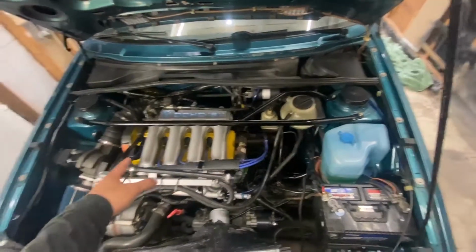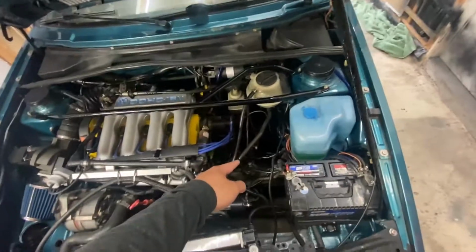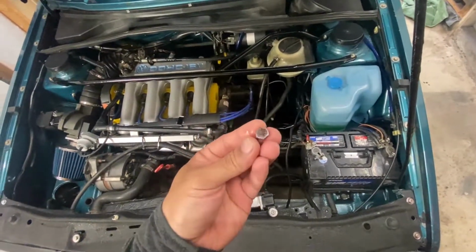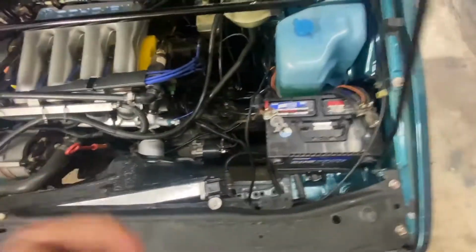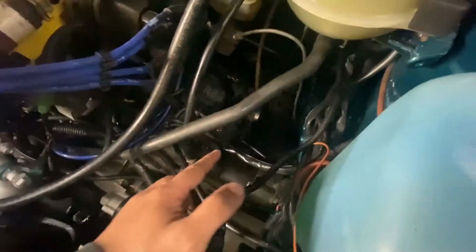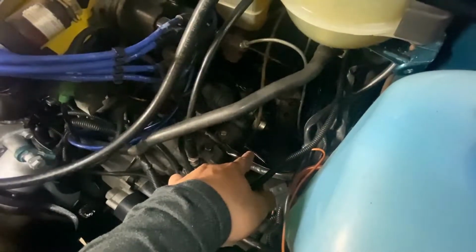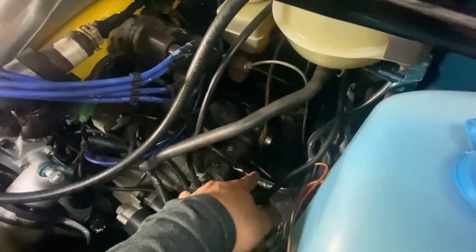Finally, I know I have a slow leak somewhere, so I was checking my oil and I was trying to check the gear oil from the speedometer cable, and ended up breaking this 11 mil bolt. So right now what I have is a sock wrapped around the bottom of that stock to keep the plate from lifting and just to kind of absorb and soak up any fluid that might come up from the trans.